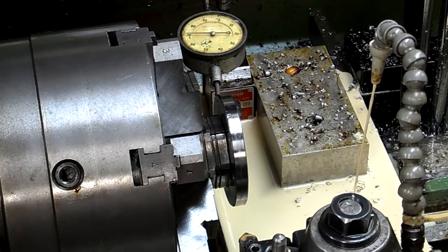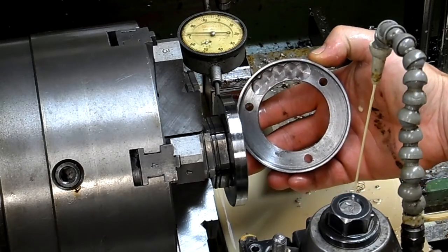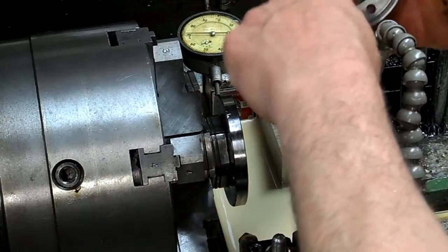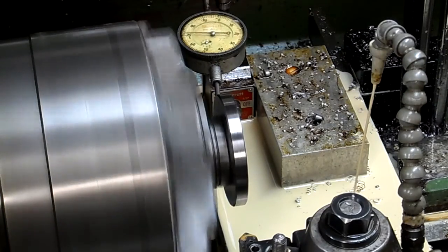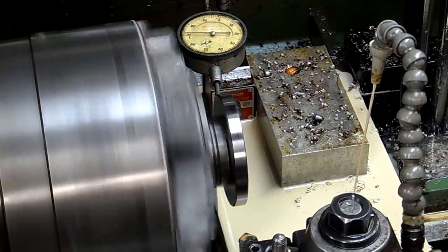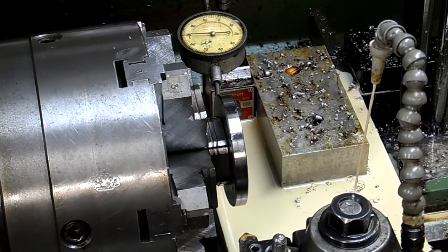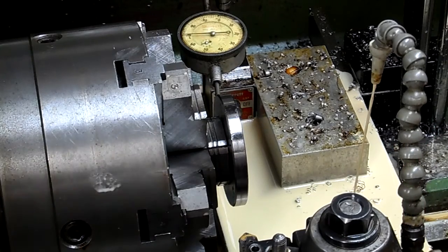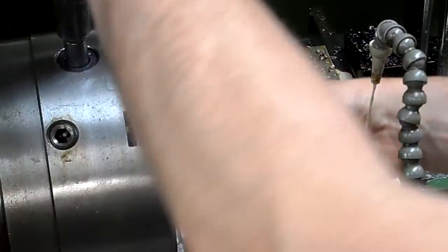It's the type with screw-on weights. Here's one of my weights — it's steel — and this is the current weight setting I'm experimenting with next. I want to put the crankshaft together; these weights screw on. I put the first half in, bump it over, and you will see — look, the indicator is barely moving. Wow, this is great. This is what a crank half should be like — it's totally concentric.